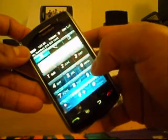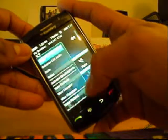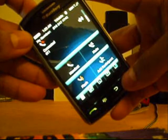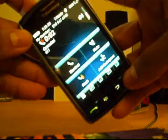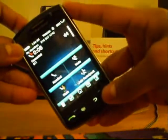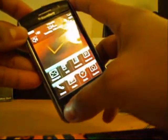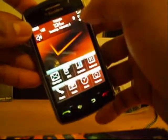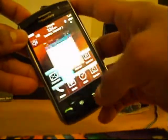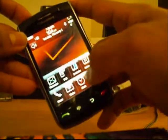I'll go ahead and make a call to the customer service number to verify that it's now on the T-Mobile network. T-Mobile. That's the test call for T-Mobile — we know that it's active. As long as you have the internet package, you will get the capital EDGE letters on the right-hand side. You'll just have to have your carrier send you the service books which will enable the browser and everything else that goes with your service.